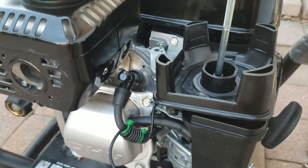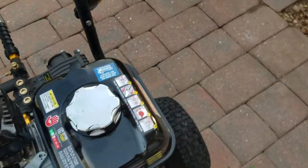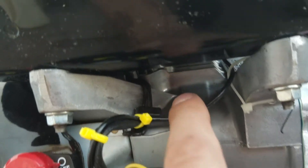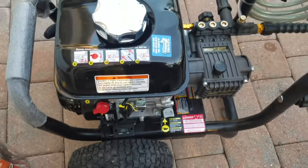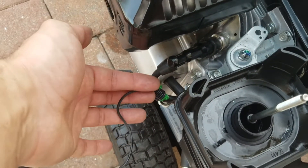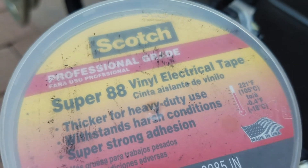So that's what we came up with — the finished install. I wrapped it nice; I used green tape to differentiate it, then wrapped it around underneath the air filter through the bracket. I kept it away from everything hot and away from the governor arm. There's enough slack in it — it's not super tight. Ran the wire down and I think it's a pretty clean install, almost looks factory. If you want to tape it, use heavy-duty tape like Super 88 or Super 33 — harsh condition, super strong. Temperature-rated. Super 33 is also good.